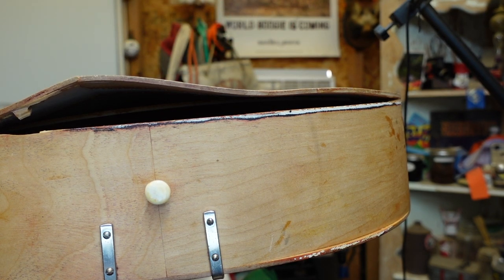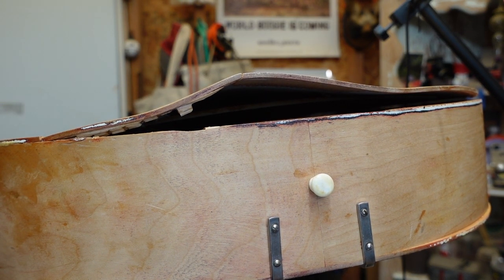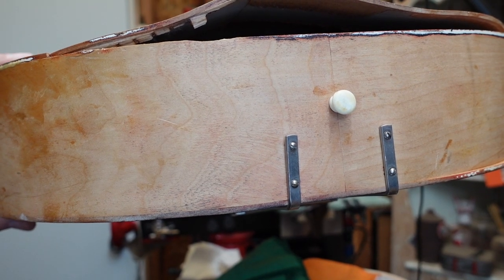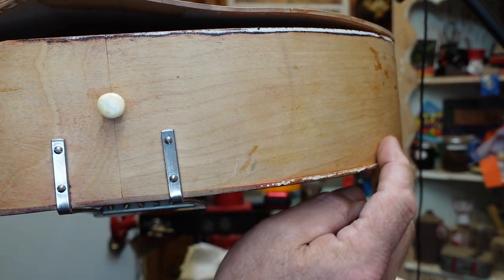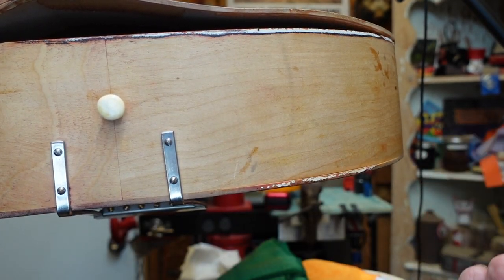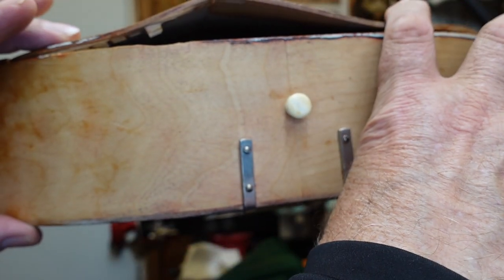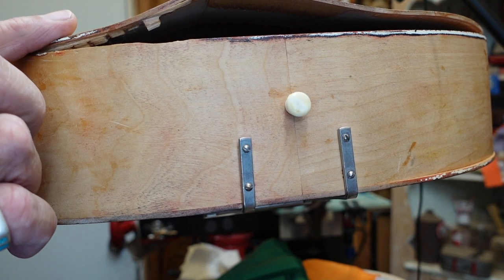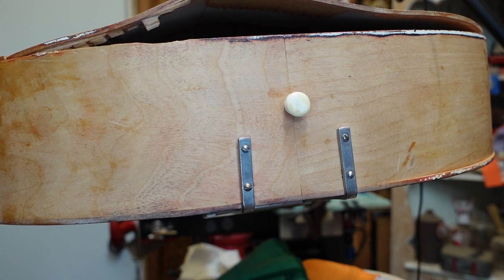I have a theoretical question for you now. Let's say we know that the rest of the body appears to be in okay shape. Let's get this camera down a little bit where we can see it. You've got some stuff sticking out over here from the top. That's not a good sign, meaning the body is twisting. If this is open up here, there's some missing. It's kind of a diagonal effect, the teeter-totter thing I was telling you about. But if I start clamping here, and I'm steaming all of this up here, would you agree that any correction that takes place here might be at the expense of something here or here, making an accommodation for it?